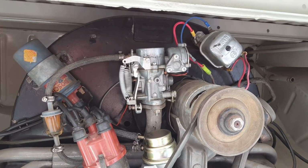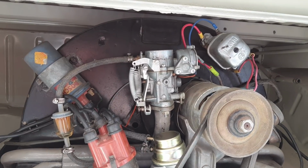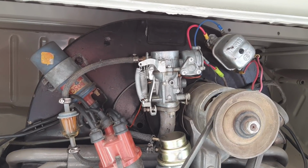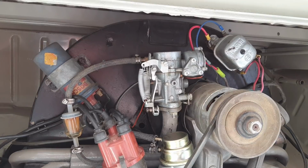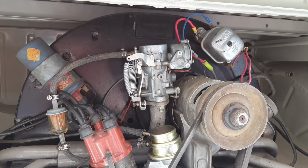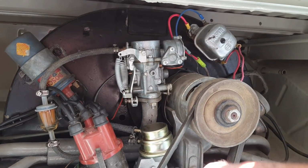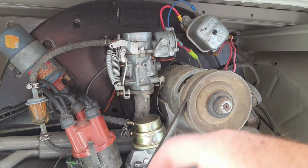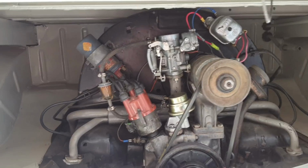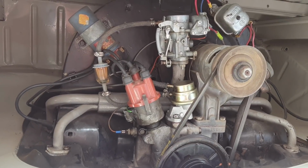Now every car had a carburetor back when I was younger. There was no fuel injection, hardly anything. The Rabbits came out fuel injected, and people used to say they had the worst fuel injection. I thought it was actually really good. It was simple. The only issue you ever had with those things was the plunger would get dirt in there, and somebody would go, man, my car runs like crap, can you tune it up? And I'd just take the little lid off, clean it, and take carburetor spray and move the plunger up and down. I'd say, go drive it, bring it back. And they'd bring it back and go, wow, you tuned it up. I know, I just cleaned your thing out. That was really easy injection to fix.